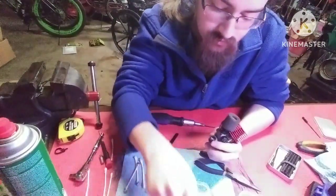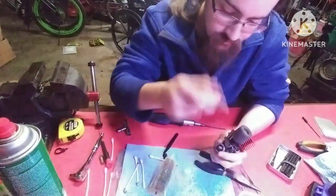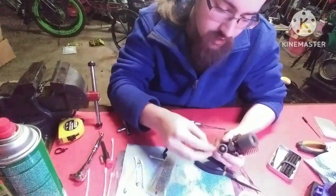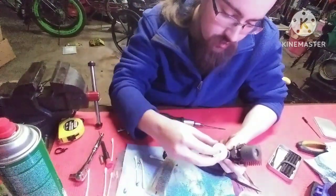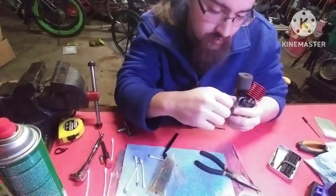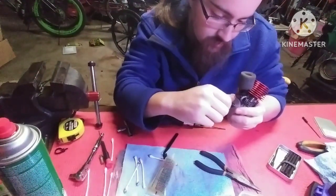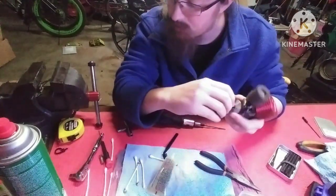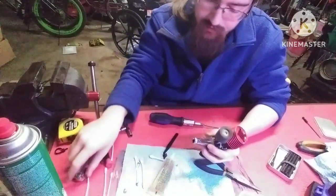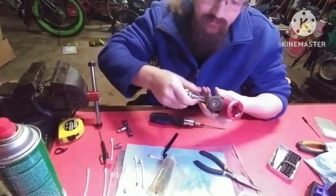For this video, I'll put this clutch back on, but I don't think I'm going to keep this clutch on here because the compression on this engine is shot. So get your collet, put that on, you get your flywheel, you put that on, you get your clutch nut, you start that. There we go. Then you get your 10 mil socket. This is a Traxxas 3.3 Pro 15 style clutch. It's a Traxxas clutch.